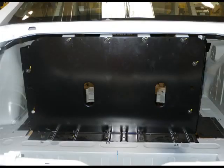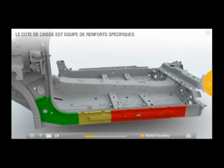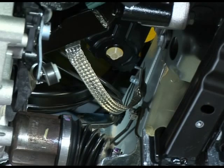At the back of the battery, a reinforced structure provides additional safety in the event of a rear impact. In addition, the body sides have been reinforced to further improve the passive safety of Fluence ZE. Numerous earth studs are present on the body of Fluence ZE, including those of the earth straps linked to components supplied with 400 volts.